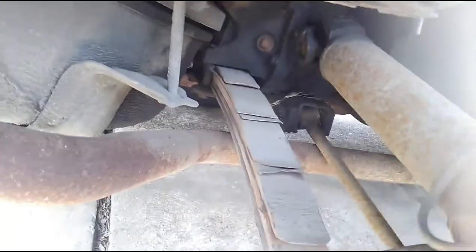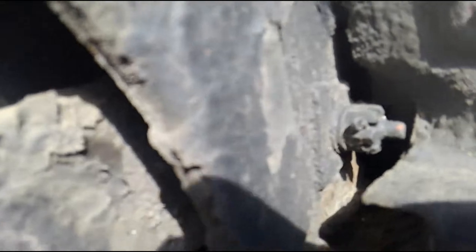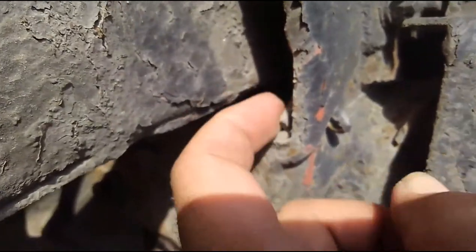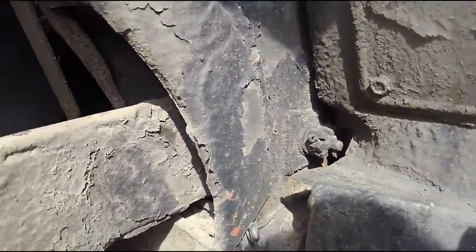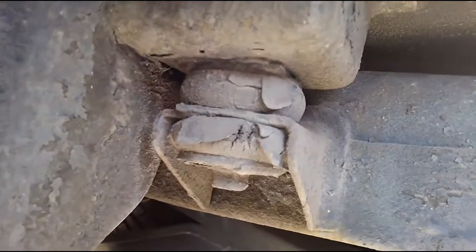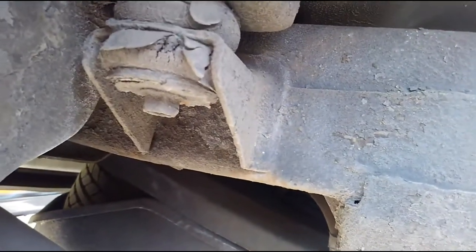That's part of the IRS rear end that Corvettes were famous for — they've had this since 1963. Your trailing arm assembly here can be kind of a booger. That nut is where the trailing arm gets held into the frame pocket, and if there's corrosion, this is where Corvettes will actually rust really bad from water intrusion. You can see a little surface rust here but no corrosive damage. There's a cotter pin that holds the shims in, which corrects your caster and camber. Behind that plate is actually a body mount — that's the number three body mount, and there's a number four body mount.